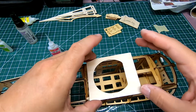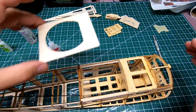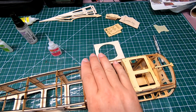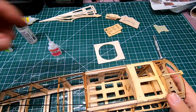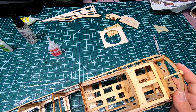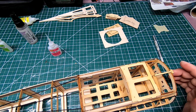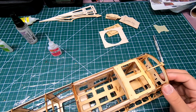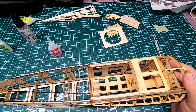I was going to put this piece on over the cockpit, but I think I'm going to leave it off. I want to make sure I can get my fingers in to do servos and such. I'll go ahead and do the sides and put this piece on afterward, after I've mounted a pair of servos and gotten some basic linkages set up. That's a better way to go because it's fairly fragile and the opening is not very large — getting my hands in there is hard enough without that in the way.